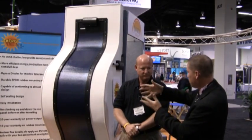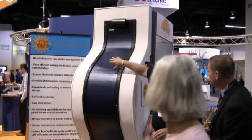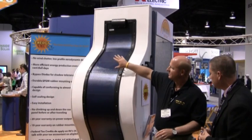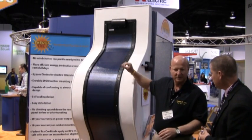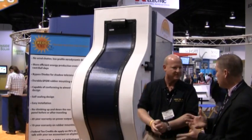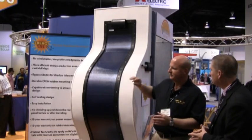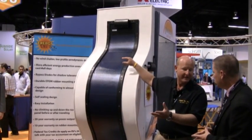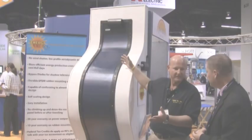After the wiring goes into the motorhome, what do you hook it up to? Because of the amount of power we have with the mat, it will go from the mat to a charge controller, and then from the charge controller to your battery system, and then off to your inverter to run the system. A charge controller mediates the amount of power going to the battery so you don't fry the batteries, and keeps the batteries sustained at the perfect level.